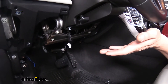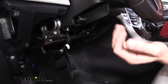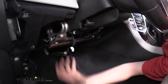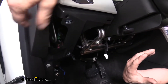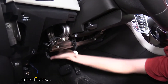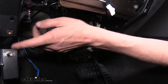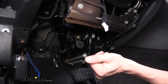We're now inside the vehicle — we did remove a couple of components to make it easier to see on camera and to work. These panels don't necessarily have to come out, but it does make your life a whole lot easier. The panel on the front actually just pulls off. You will have to pull out on the side trim piece just a little bit to get it to clear when pulling it off. Once you get this front piece off, there is another piece that runs across the bottom like a kick panel cover — that one has several push pins and two screws. You can't access those screws until you've pulled off that first cover.